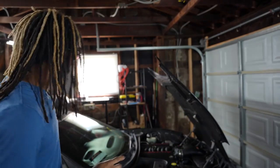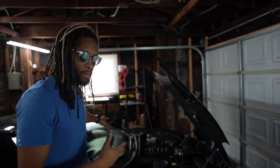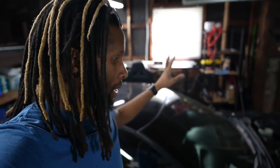One of the biggest things though: check the very simple stuff first. I wanted to make sure the glove box light wasn't coming on, the vanity lights weren't coming on when the vehicle was closed, because I had cleaned the vehicle and thought maybe I turned something on by accident. I made sure the dome lights were off — just all the small little things — before diving into anything else. Checked all the interior pieces, made sure nothing was going on in there.